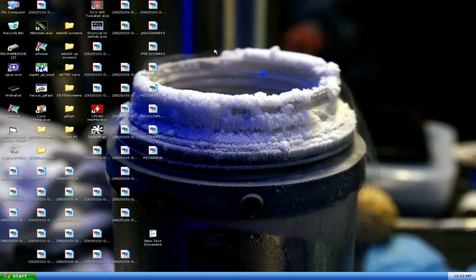So 2135, and I actually tried the maximum FSB as well, and I was able to do up to 640, 650, somewhere around that mark, and even SuperPi 32M stable at 600 FSB. So I think it's quite good, but I really don't trust the maximum FSB tests with CPU on air cooling, especially the maximum high FSB SuperPi 32M. You really have to put the CPU at least on cascade cooling to try that properly. But I was able to boot into the OS at 650 FSB, so I think it's quite a good result already.